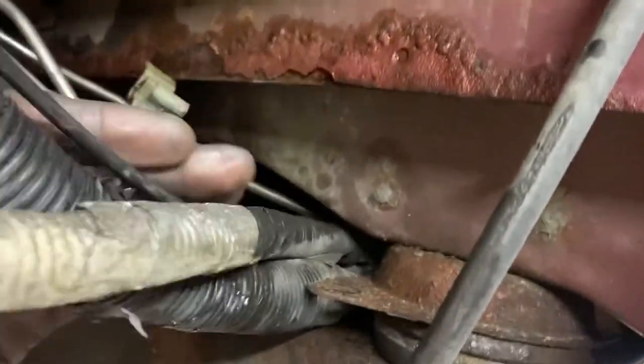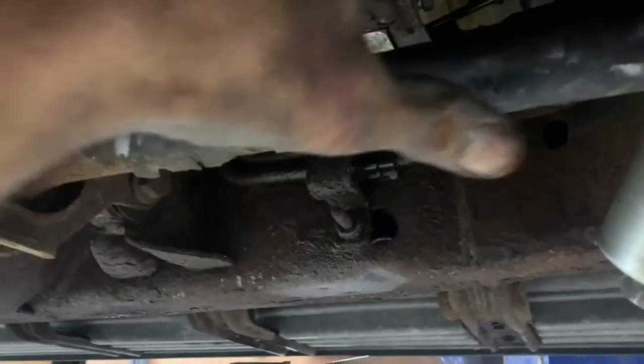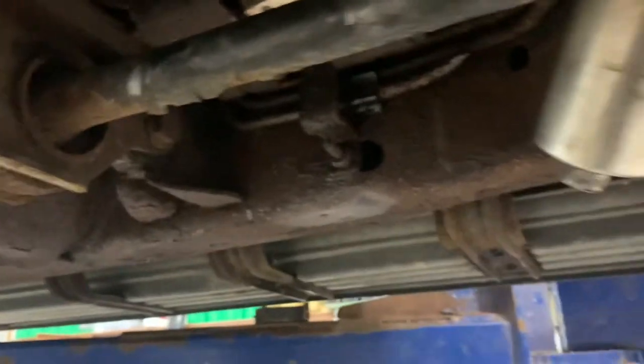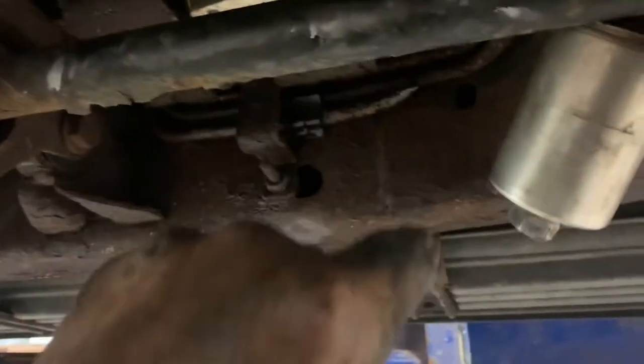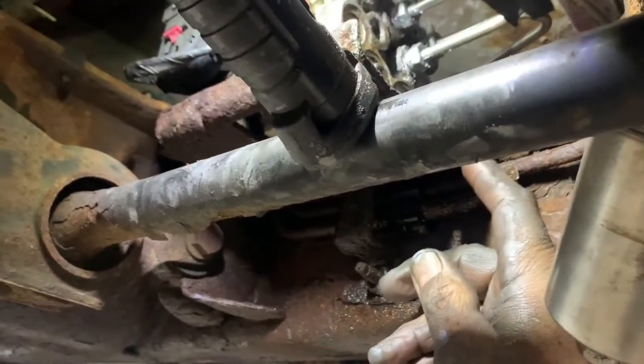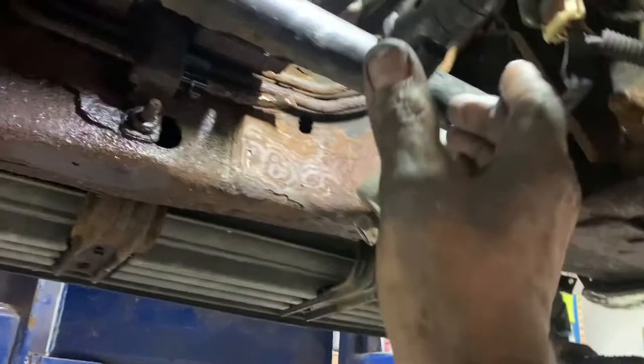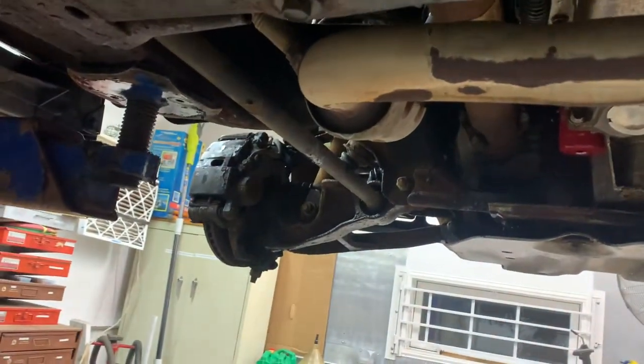Stick it down through inside here behind the harness, push it through, pull it through, and then stick it up over the top. Then you want to go in underneath all the brake lines and put it in the spot on the ABS unit. It went on the far right of the ABS unit according to our diagram. It looks pretty good underneath, so I'm going to straighten it out, get it started, and tighten it up underneath, then go on top. It's in there and it's tight. Now I've got to lower it down and get it up to the master proportionate valve.